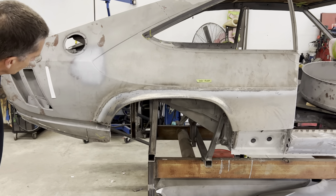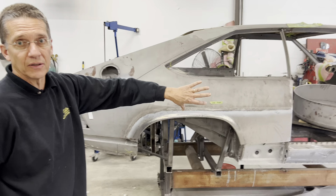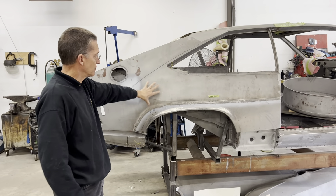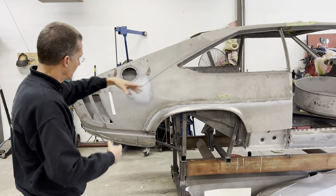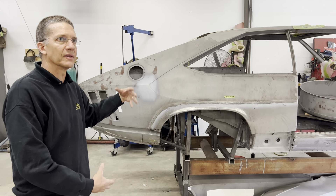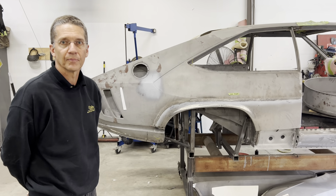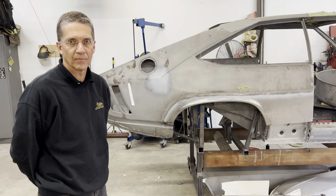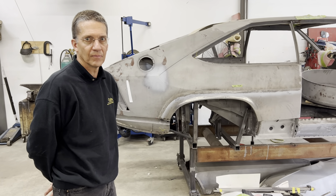It's obviously not done yet — it'll be touched up and this is to hold the shape. The next plan, after the doors get skinned and mounted to set the location of all the body lines, is to remove the quarters so we can properly finish them. The body will be sandblasted so it's all exposed, then epoxied correctly inside before we assemble everything. These quarters are going to be finished on the inside as well as the outside, which was never done on Italian cars in the 1970s — and that's the thing that will prevent this rust from returning.